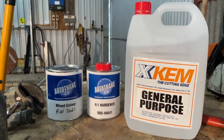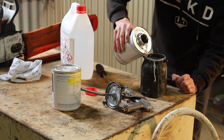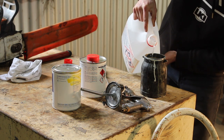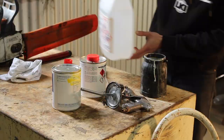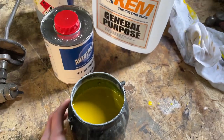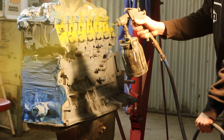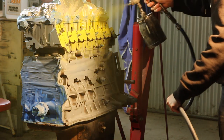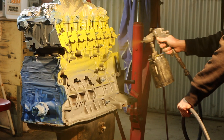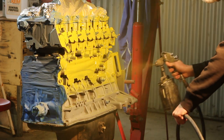For a topcoat I'll be using what I thought was a caterpillar yellow — or hoped might be — but it is pretty bright, so we're just going to roll with it. I have a four-to-one hardener ratio and I'm going to use about 15% of the mix as thinners. As with any paint mix before you put it through the gun, you want a milky consistency. I started out pretty light, but don't be afraid to go a little heavier with two-pack. When painting an engine block, even if there are some runs, you won't really notice — two or three heavy coats is better than a heap of small thin coats.